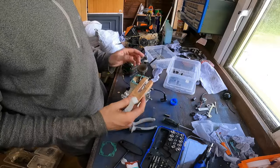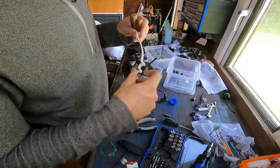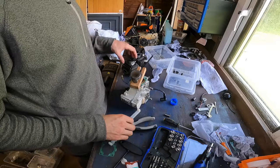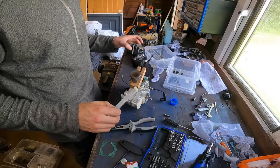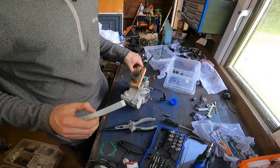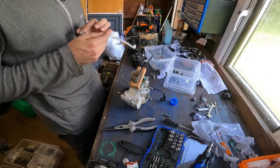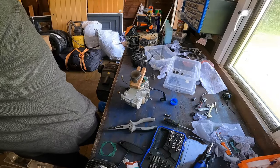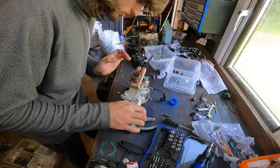So I've got my little block of wood. This comes as a kit, and it's a Stihl part. So I'll try and find a link and put it in the description for anyone wanting one. Take them out of there. What I'll do in another video is show you how to do base gasket deletes, which adds a little bit more compression to the saw, especially if it's an older cylinder and piston, you can get a little bit more out of them. And with new ones as well, you're definitely getting a lot more compression.